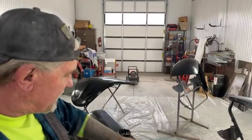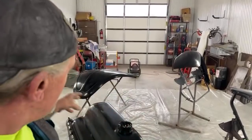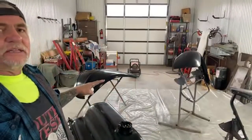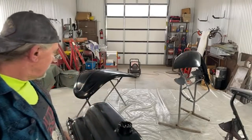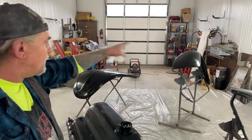So what we just did is we learned how to sand our intercoat clear. We also saw that by laying down that clear coat, bam, bam, bam, one coat after another, it flows out and lays down super clean. No orange peel, no Rhino liner look, okay? No Rhino liner, bed liner crap going on here. Nice and smooth, and this is now paint ready. All right, all these are.